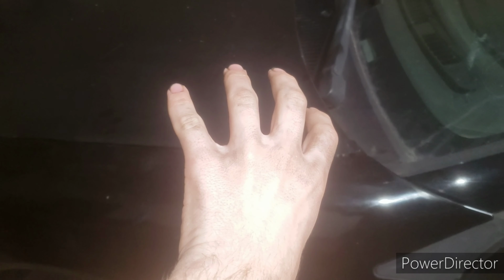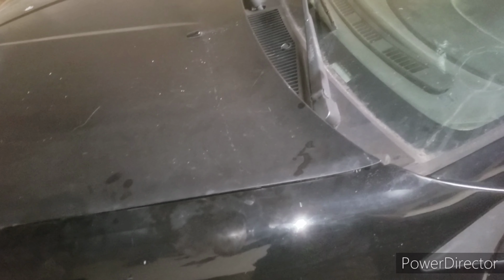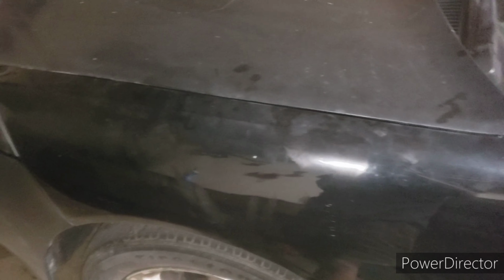go ahead and twist the rack. The rack will sit here. You'll twist the rack like this, and then pull it out, lifting up. And it's better if you have a person on the other side to lift up with you. And you'll remove the rack from the car, and everything's reverse to install. It was actually very easy compared to what I was expecting from this car.